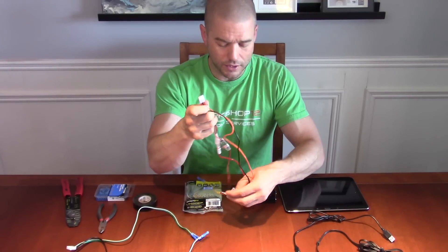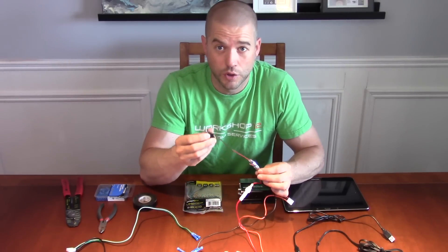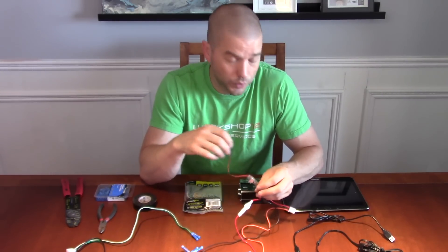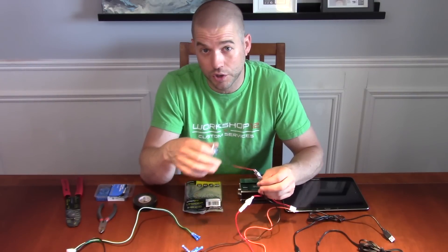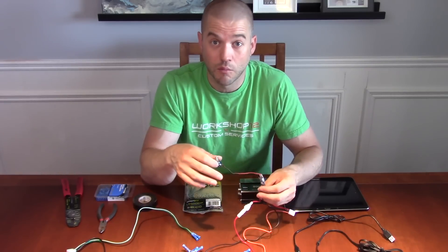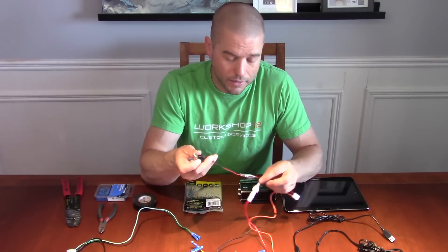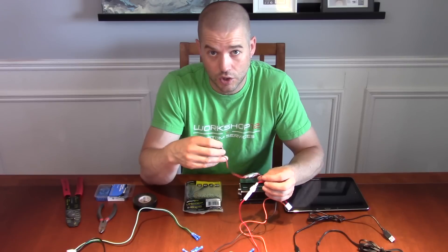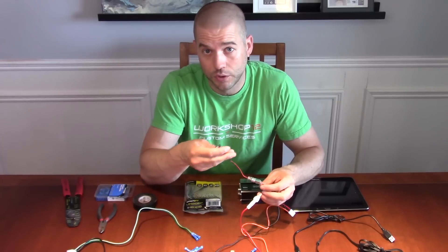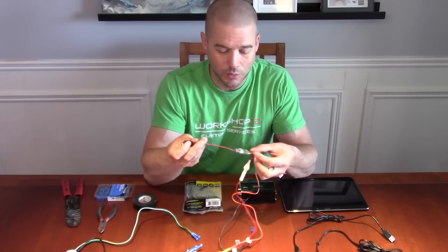The key thing you'll want to do off of your power source is run your USB power to charge and power your tablet. The cool thing about the tablet is it has a battery, so it can stay in sleep mode when your car is off. The power settings I posted earlier allow it to come right back to life when it sees power coming from the accessory source. The main thing you need to do for USB power in your car is a step-down — USB expects 5 volts and your car is 12 volts.